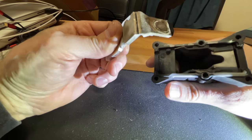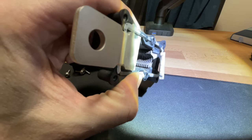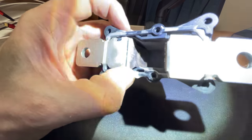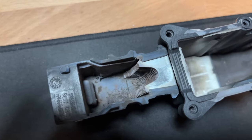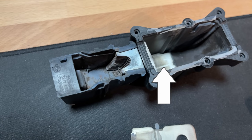There are some other interesting bits in here. There are these radiator fin looking things, perpendicular to the explosion direction — I think they're there to make the explosion change directions to reduce its energy. Then the explodey gas has to turn again to go around to the other side, and then through this filter material before it gets out of the fuse. This keeps all the explodey bits from getting all over your battery.